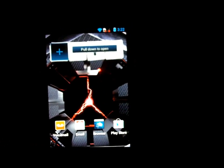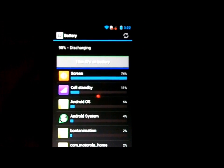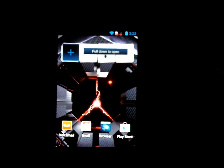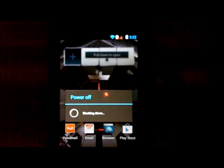Make sure you have plenty of battery. I'm going to check - I have 90% charge so battery life is very good. Then power the device off using the power button on the side. Also make sure that the update zip is on your micro SD card. You can also put it in your cache partition if you don't have an SD card.